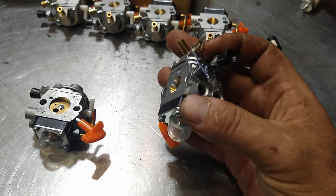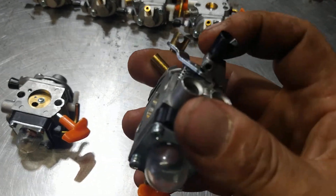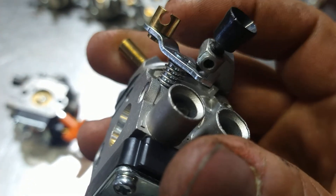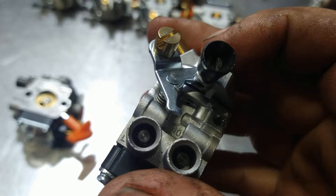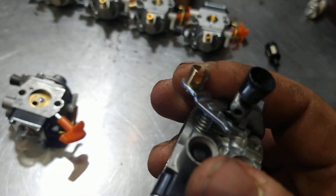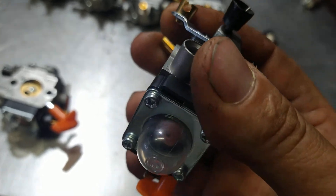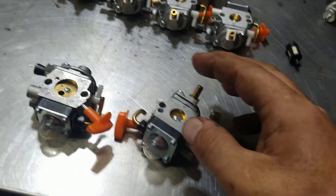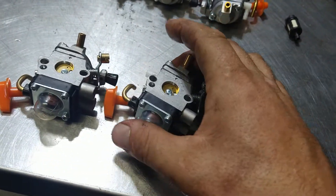But they had made a mistake on one of their carburetors. It was a simple mistake — it was this barrel here. See how you can see all the way through it? Well, before, it got thin on one side and was fat on the other side. And when you put the throttle cable in it, it would partially throttle it up, so you could never get it to idle. And all the different Chinese carburetor companies that are out there had the same mistake.